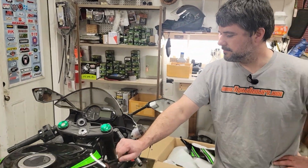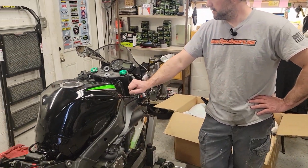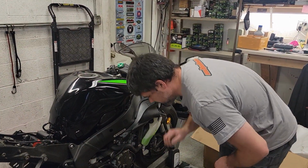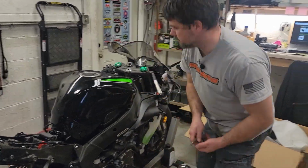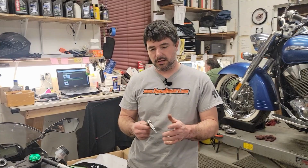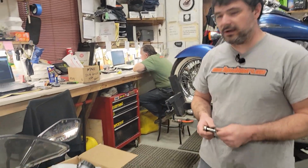Yeah, guys, a lot of this stuff really is, as far as the fairing portion of it, pretty self-explanatory when you're taking it off. Mounting points really don't change, especially with the ABS stuff, because it's all OEM. You take plenty of pictures and you look at where all the stuff comes apart. It's all the same mounting points, and it's going to accept the same screws that you're taking out of your OEM fairings. I've not run into any issues where you need a wood screw where there was a machine screw that was supposed to be there. Right. So it's really good stuff in terms of that.